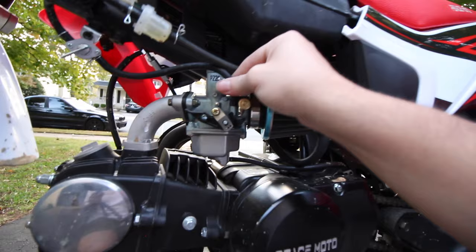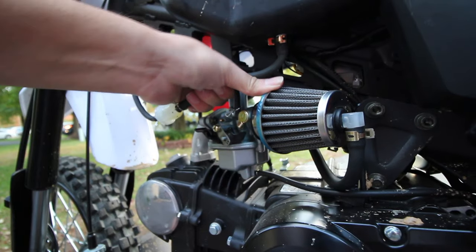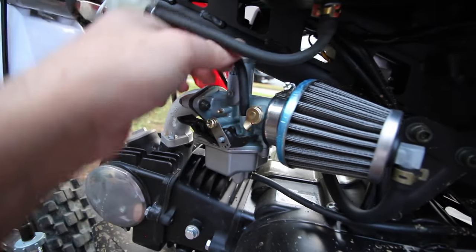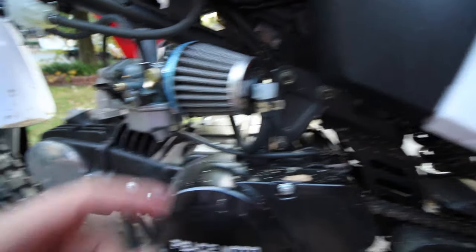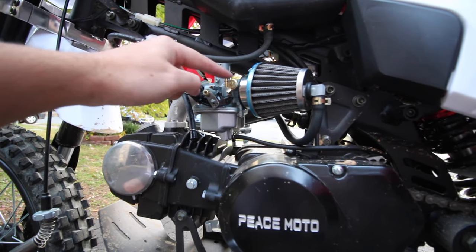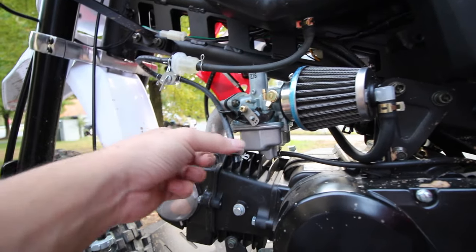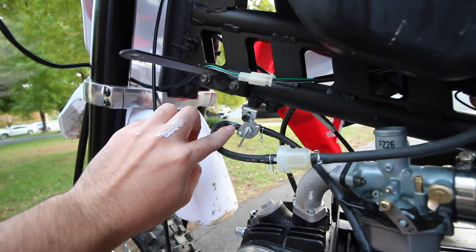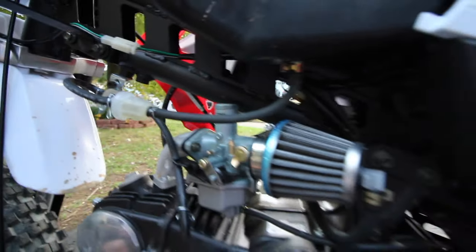We're going to remove the air lines and the fuel line and pull it out. Here's one of the fuel lines — give it a pull. It's stuck in there pretty good, so I'll take it off from over here. There we go — it sits on this little needle right here. It leaked a little but that's just residual gas in the tube. The shutoff valve stops gas flow, so don't remove the line from the valve side — remove it from anywhere between the valve and the carburetor.